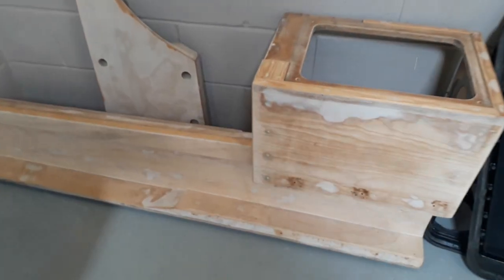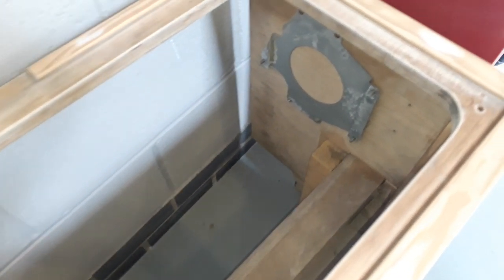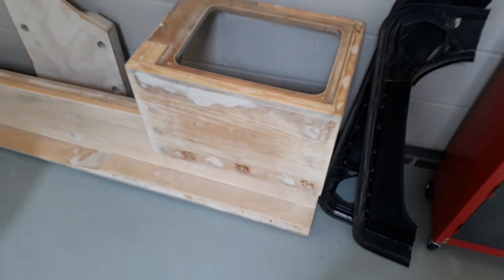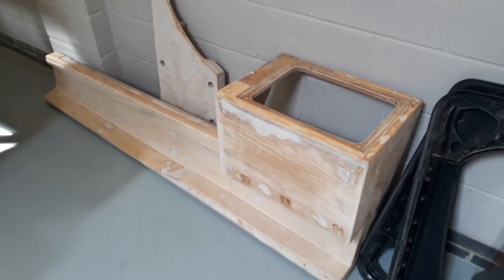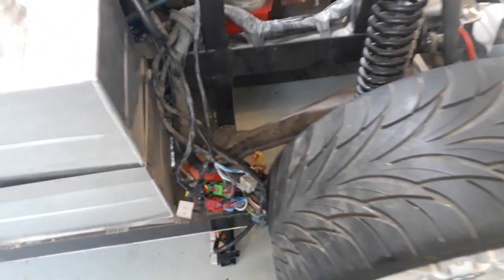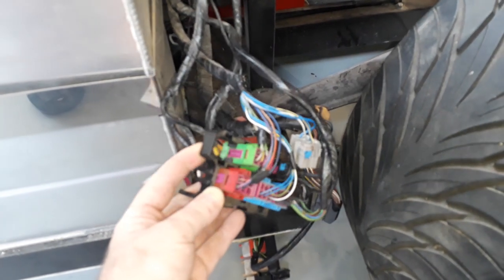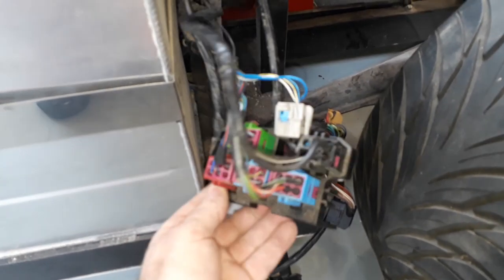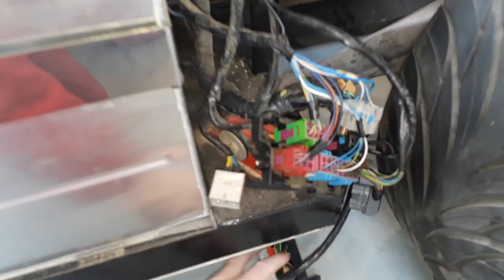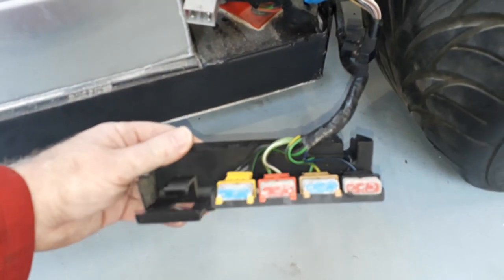This nacelle has been removed from the car so we can take a better look. On the inside you can see the bracket for the ECU and where the screw holes are holds another bracket for those connectors. This is obviously all made out of wood for now — it will be made out of fiberglass and will be weather protective, so rain shouldn't get in. These connectors are not really designed to be outside in all weathers — they are internal connectors — so I didn't want to expose them to cold, sleet, and rain. That's the reason why I have the nacelles either side of the car. Here's just a set of fuses which came from the original donor car.